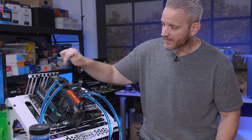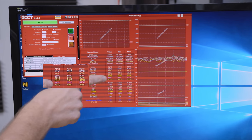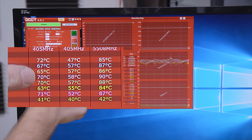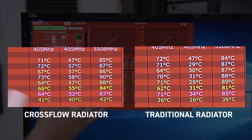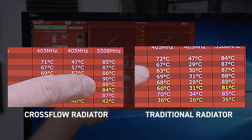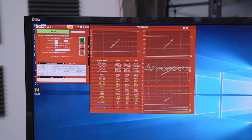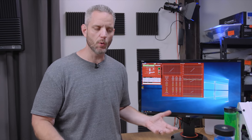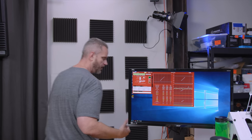Something worth pointing out: we stayed well below the temperature threshold where the fans on the Poseidon would actually turn on, so everything cooling-wise was down specifically to the radiator. After switching and running for 20 minutes, it looks pretty much the same — I'm seeing more 60s than 70s compared to before, maybe just a couple degrees lower. But looking at the spikes, one core did hit 90°C, and the spikes might be overall slightly higher. This isn't enough for us to draw a conclusion on whether cross-flow cools better or worse. We've got to put it under load with the GPU.